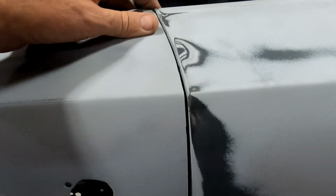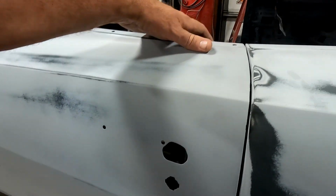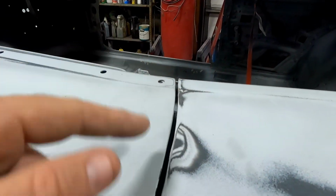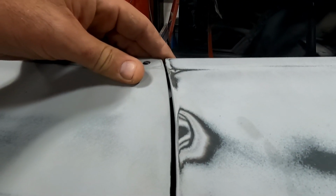And then to get the door matching perfect, I put, you can't see it in there, 30 pounds worth of chain. So now my door shuts perfect, and I like the tight gap. I may grind a little bit off of this and a little bit off of this because it's a little tight. Maybe with chrome on it, it might be touching.